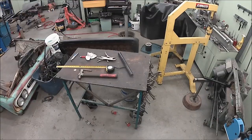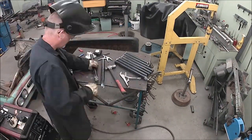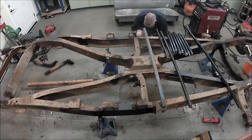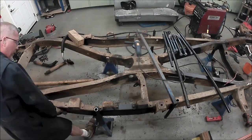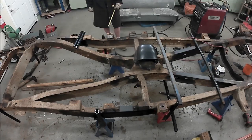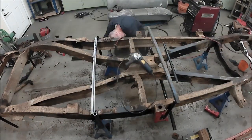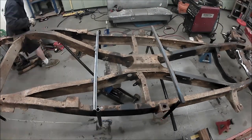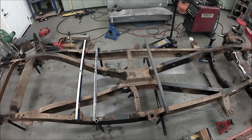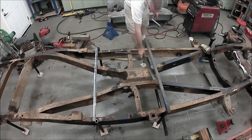Then we're going to get into shortening the frame. I haven't found anybody who has shortened these frames — they usually either lop out the X completely, which I think cuts the strength in half, or they switch to a 63-up frame which has no X in the middle. I think I can shorten this frame and keep the X, and I think it's going to be awesome. As far as I know, I haven't found anybody else who's done it or at least documented it on the internet. In the description below I will put a link to my tutorial to show you how to shorten the frame, including where to measure and where to cut. I welded on threadable legs so I could adjust the height at every point of the frame, so once I cut it in half I can re-zero and re-level it. Welded on a bunch of braces to keep the frame from moving once I cut it. This is sped up ferociously — I spent a lot of time measuring and thinking and looking at it.